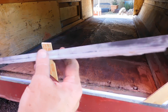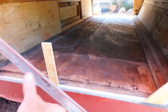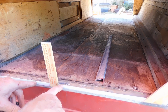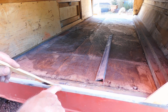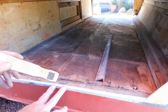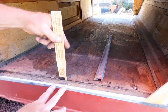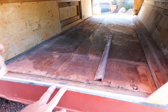We've taken all the original trim with this paper-thin aluminum sheeting and hammered it all as straight as we could, fixing the curves and whatnot. This is a true restoration — if we can fix a part, we're going to do it. I've got three wood shims in here working like spoons to pull the siding away from the edge of the wood frame. I'm going to pull off the double-sided paper and seal this aluminum to the wood frame where it was never sealed before, to give it a little bond and a little water sealant. We're also going to place some flexible sealant in this groove right there.